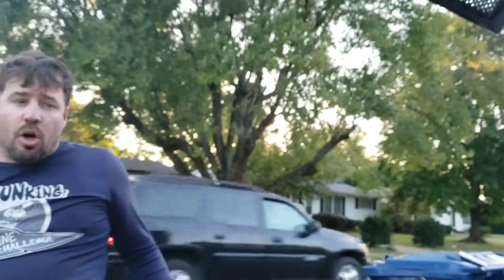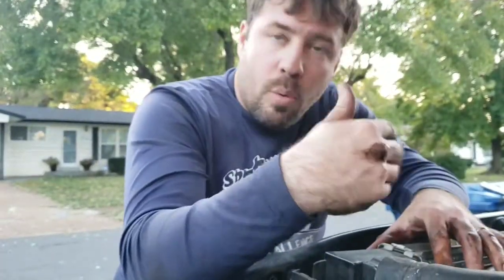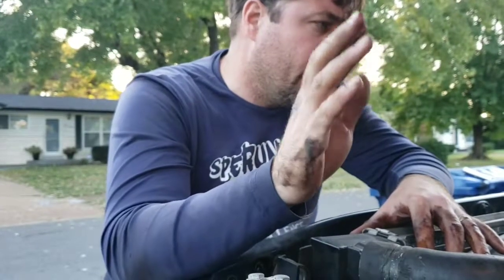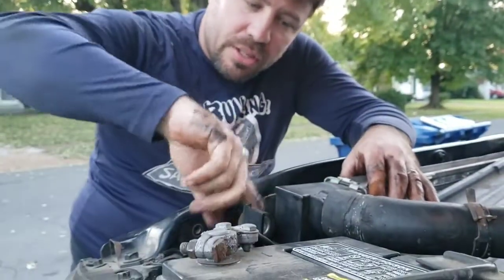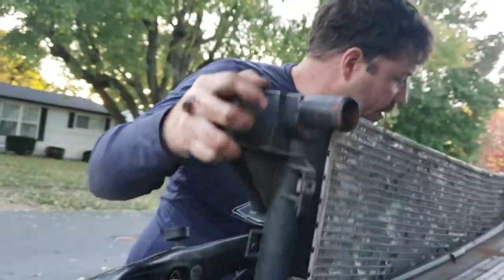I paid a lot for this one — I got it at O'Reilly or Advance because I needed it right then. We had negative 9 degrees actual temperature, like 20 wind chill. I drove the truck, let it warm up, had a 50/50 coolant mixture, no water in there. Ran it for like a half hour, went and drove, sat at a light, thermostat opened, heat came out, and this whole square part blew out the front. Not fun.